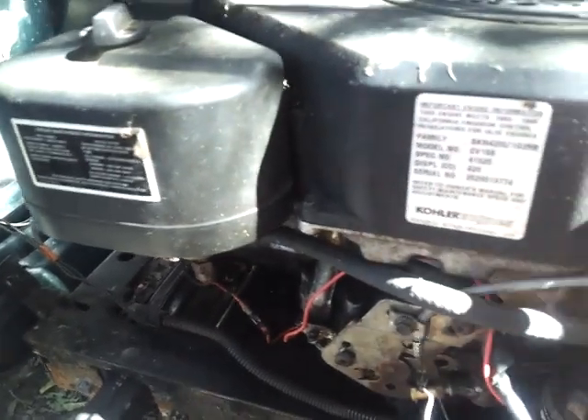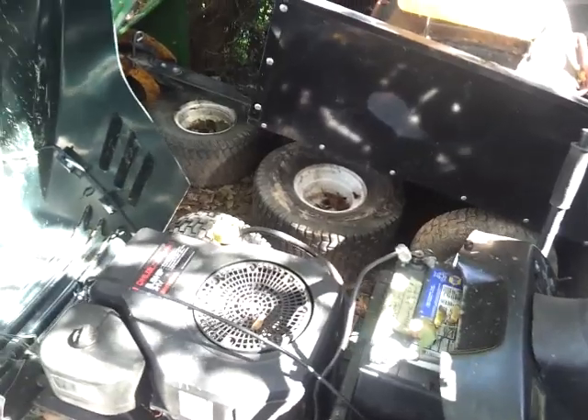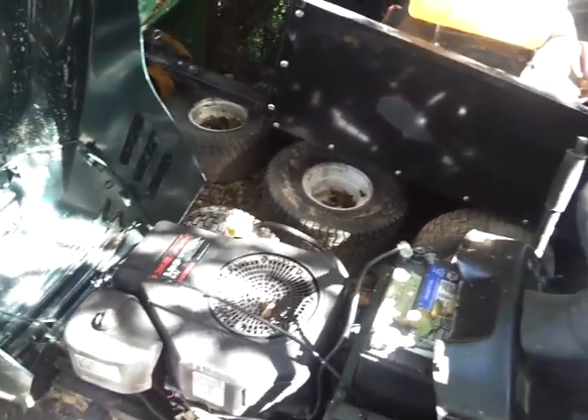It's a very similar setup. It's a four-wire hookup right here because that controls my carb solenoid, which you do not have. It has two lines off the stator and my kill wire. Right in this black here, there is the resistor. Basically that red wire goes up to my key switch, and I believe two wires go into my key switch. The other wire comes back out and goes down to my solenoid. Basically the wire from the solenoid in normal operation is providing constant power to my key switch, but then when the engine is running it's working backwards and it's charging the battery — power is coming out of the engine, going back into my battery.